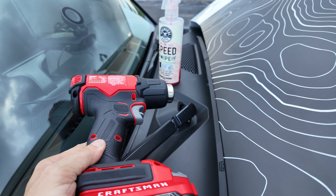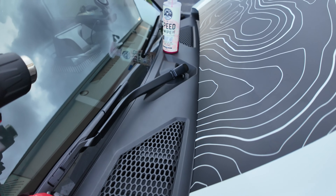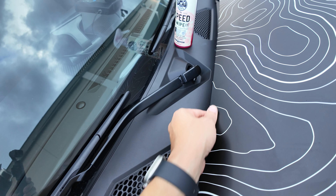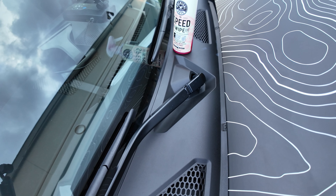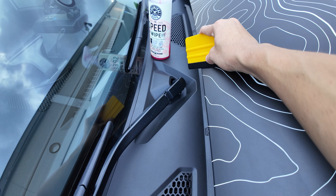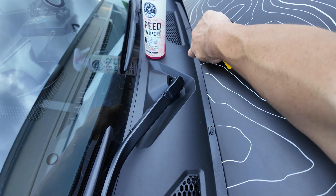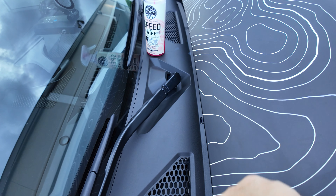I let it dry out a little bit more, then used my heat source — I heated all of this up and with my other hand pushed down the same way I showed earlier. Once this is down and you're sure of it, run your finger gently under there; apply a little bit more pressure and do it again — you're trying to feel if it's all down. If you have any bubbles right along this ridge, take your squeegee at an angle and push all the way back to the inside to see if any liquid comes out. You may need to repeat the process of heating it up and pushing down, then run your finger along the seam once more to make sure there's no liquid stuck in there.